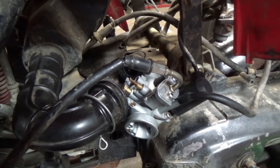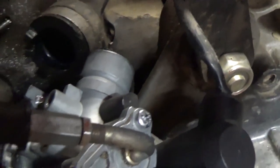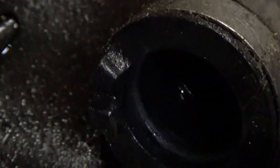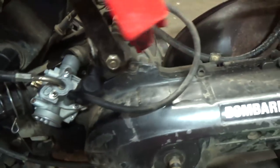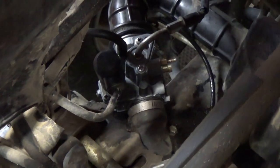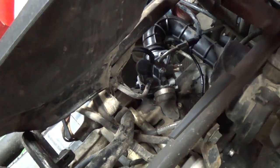I've got the tape pulled off the carburetor. The first thing we're going to do is get the back of the carburetor into that rubber boot, and you want to line up this little fin here with that little groove on the boot. Then you can go ahead and tighten up your strap. Come in from right around here and tighten that up. Coming in from the top side, make sure you're lined up and locked in place — that'll ensure your carburetor won't spin left or right — then tighten up that tie strap.